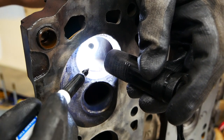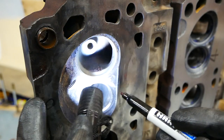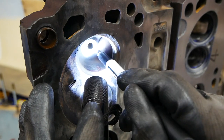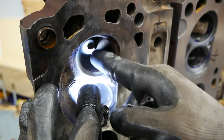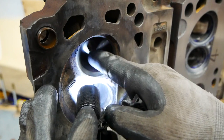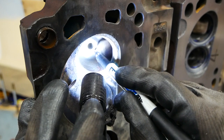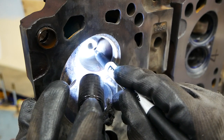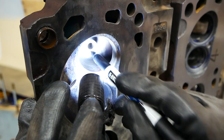One of the things there was a lot of conjecture about is the valve guide. On the intake, the valve guide creates an eddy on the backside which might actually help mixing fuel and air, but from everything I've read everybody wants it milled down a little bit and rounded out. So I'm rounding this ledge out all the way to just a hair around where the valve guide actually is — I don't want to get into the valve guide but I do want to round it out to that.